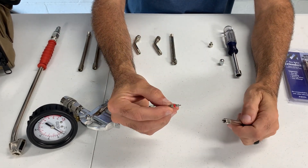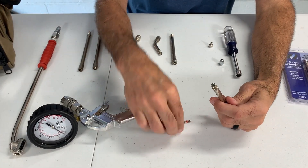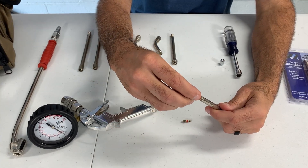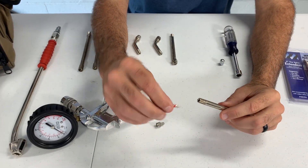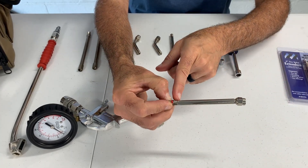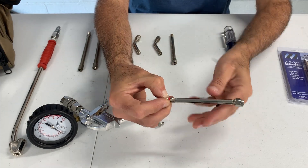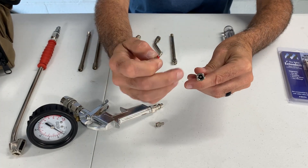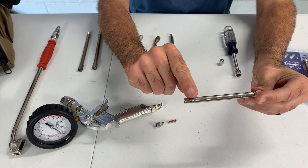This is the actual valve itself and it's installed on top. The way you take it out is with a core remover — you stick it in and it lets you unscrew this valve. What this means is that this valve only sticks down about this far, which means that as you're driving, air is being stored and captured in this shaft. There's a little metal nub on the inside that, when you screw this on, pressurizes this whole shaft. So air is being stored in here.